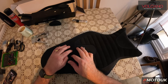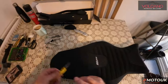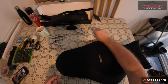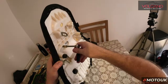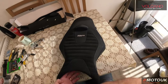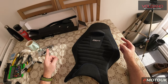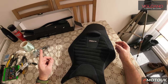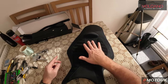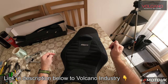Now I need to feel for the two bolt holes and make a cross-cut with the blade so I can get the bolts through the cover. Always easier taking things off than putting them back on. There she is — one seat all finished and looking great. Total cost: £130 for the seat cover, £65 for the seat gel. I did buy too much gel — if you only want it for the rider seat and not the passenger section, buy half the amount. They do sell it in smaller quantities, so have a look on their website — link in the description below.